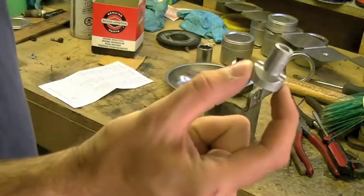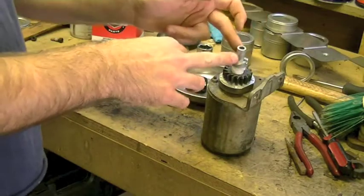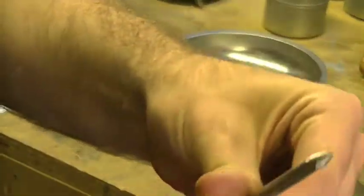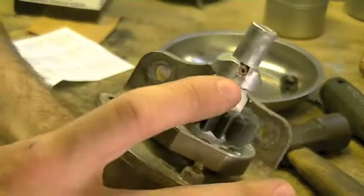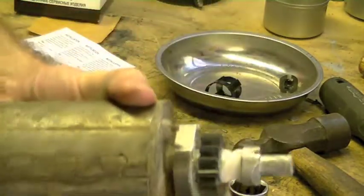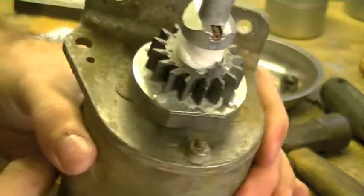Next up is the metal shaft assembly, which drops on top of the shaft. Take your roll pin, line it up with the notch on the shaft assembly and the starter shaft, and drive it through with a punch. A screwdriver of the right size works as a homemade punch. If there's too much flex in your workbench, go to the vise — place the metal part of the gear on the vise and hammer it in from the top against a solid surface, and it goes in fairly easily.